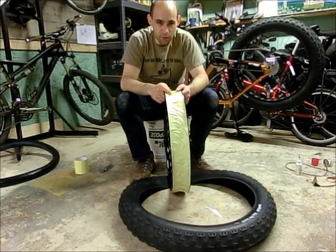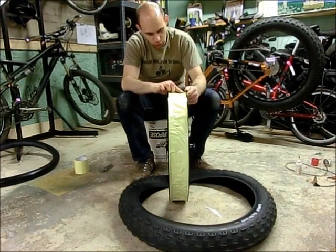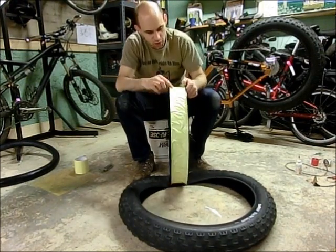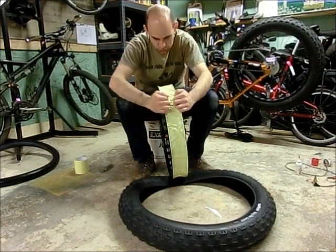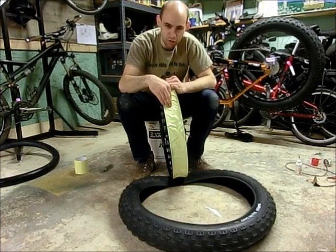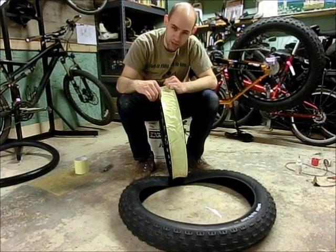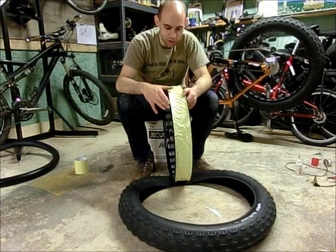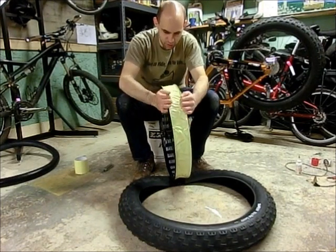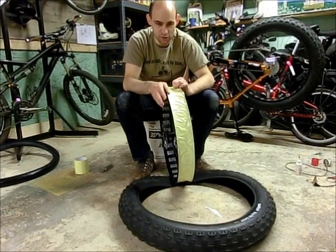When you're putting this tape on, the really important thing is you don't want to get wrinkles around the edges of the tape — you want to put it down as smooth as you can on the edges. Wrinkles in the middle don't matter at all because the air is not going to get in through there. Where the air is going to get in is when you have wrinkles on the edges. So try to get a nice smooth even coat on the edges and leave the wrinkles in the middle.